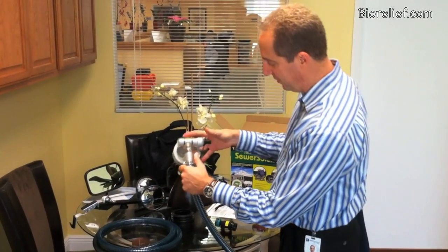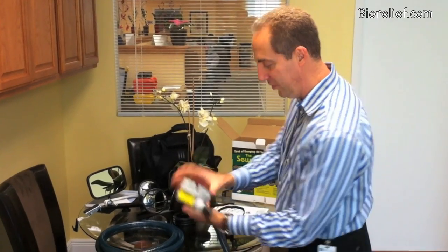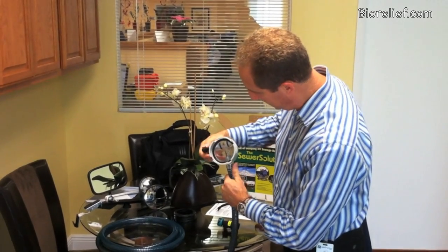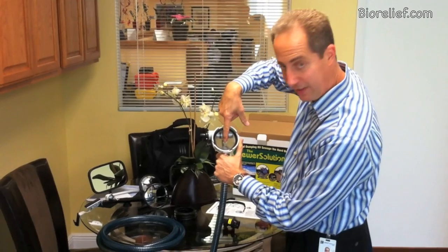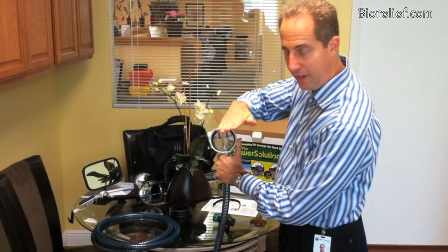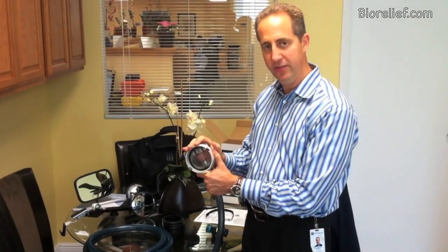After you're done cleaning, we have this little flip switch over here. When it turns, you can see inside here the nozzle gets redirected back up into the black water tank. So this here is the clean-out position, where the water gets sprayed down into the hose, eliminating your waste, and then in this position it's sprayed back into your black water tank. That's it — next I'll show you how to hook it up and how to use it.